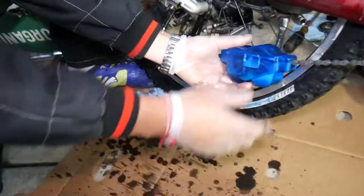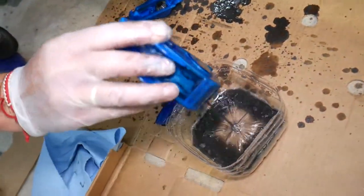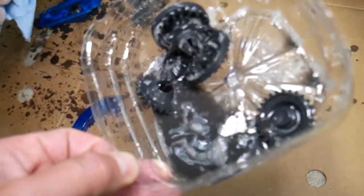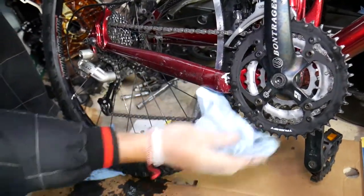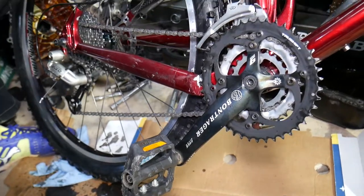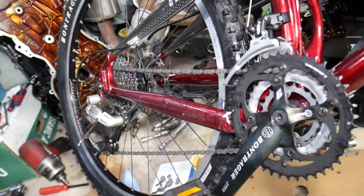We did one more pass and it's just unbelievable. Then you'll want to power wash the wheel and the rear cassette — it's still pretty nasty but you can remove and clean it further if needed. Check out what we got after the chain was supposedly washed with a power washer — all that was inside. All that buildup makes your chain slow, not contacting correctly, jumpy, and losing power. We're going to wipe everything really well. You can use a water hose to rinse everything off, and the brushes included can clean the cassettes — the chain carries the degreaser all the way to the cassette and breaks everything loose.